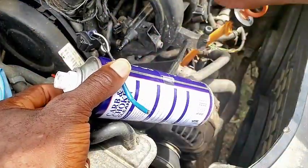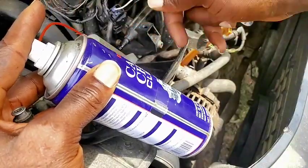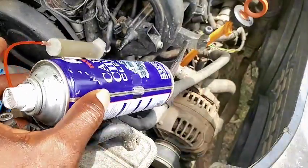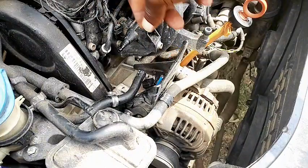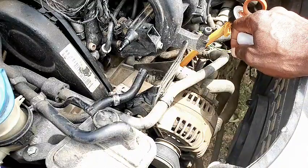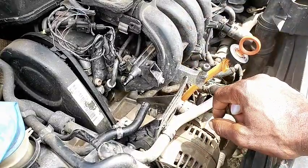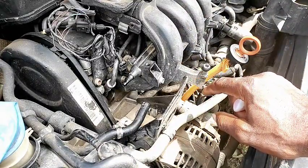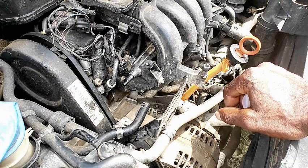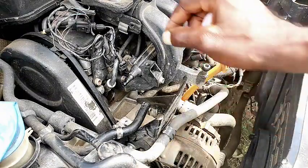Once the wires are linked and you connect them to a 12-volt battery, push the syringe plunger hard, multiple times. When you push it, it will automatically start flushing the injectors, sending the dirt inside into the engine. The dirt particles are very micro and cannot harm the engine, so don't worry. The only thing to expect is that when you want to start the car after this process, it will have some hard starts — you'll need to crank it a few more times before it starts.